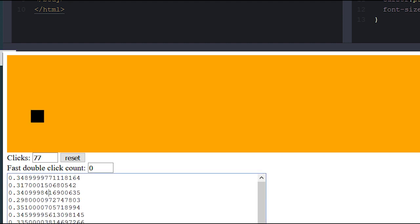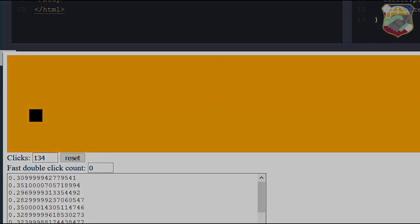Now, if cleaning and sanding it doesn't fix it, of course, your last resort is to replace the button, or you could swap the buttons. You could swap the left button with the right one, or if there are extra side buttons that you don't use, you can swap them. That requires you to desolder and solder them again. So that's pretty much all I have.